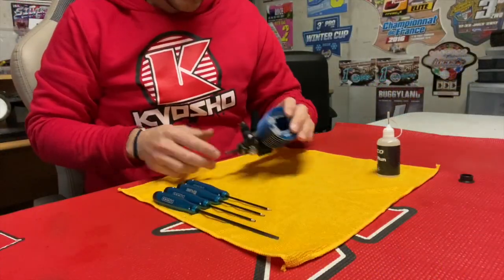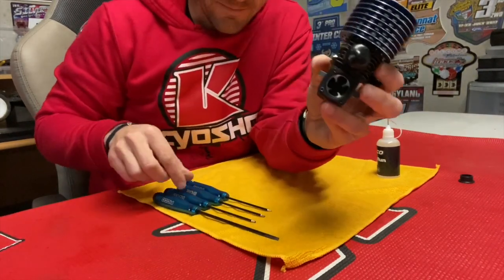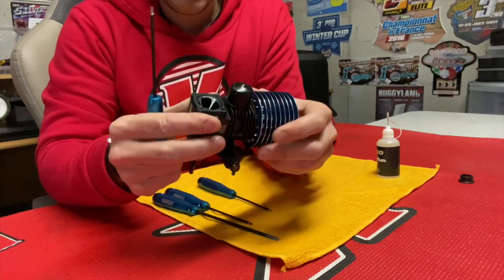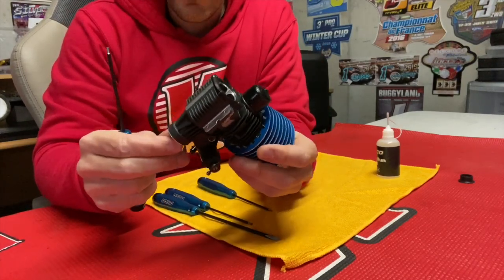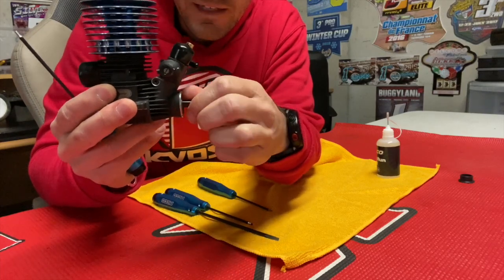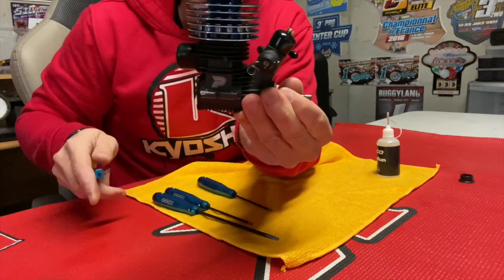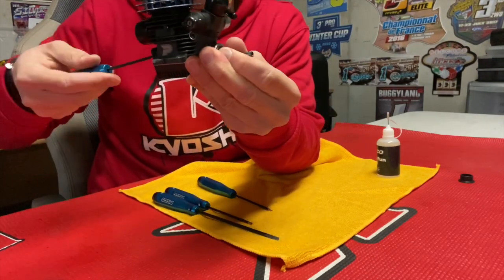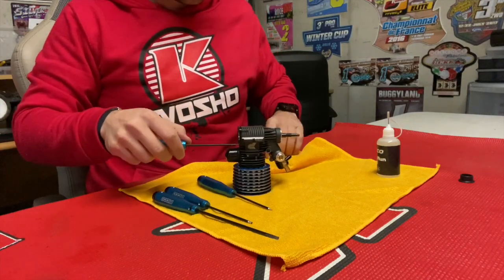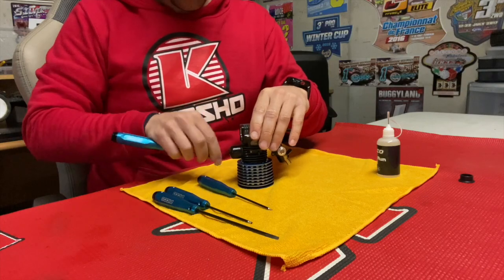So first, you just take the backplate out of your engine. It's not really hard. You take a 2mm screwdriver usually. You make sure that the piston is on the top, so you just spin your crankshaft until you can feel that you're going to the pinch, so you keep it on top, and then you unscrew all 4 screws from the back plate. Usually the best way is to keep the engine on the head like that.